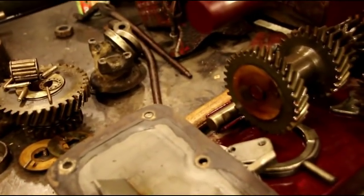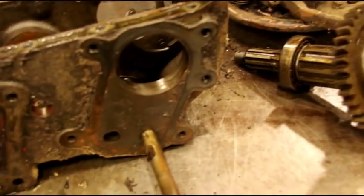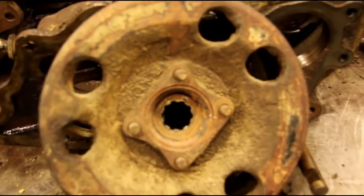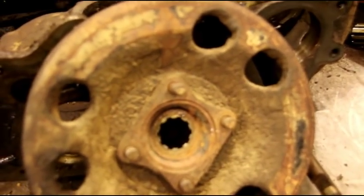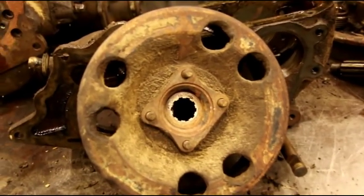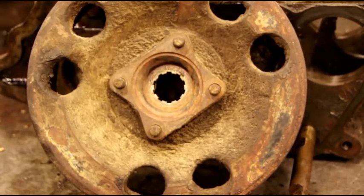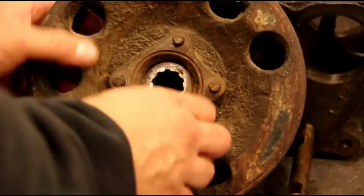What I'm doing today — I get a lot of requests and I actually didn't think of it in time when I was pulling this transfer case apart — I get a lot of requests for how to get this rear drum and flange off. I guess I didn't show that in my transfer case rebuild, so today we're going to make a puller for that and show you guys a simple way to get that off. Whether you've got to rebuild your transfer case or maybe you're just changing your brake shoes, this is what's going to be staring you in the face when you get your driveshaft off.